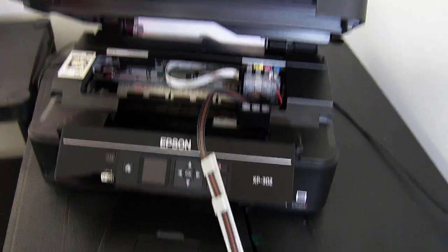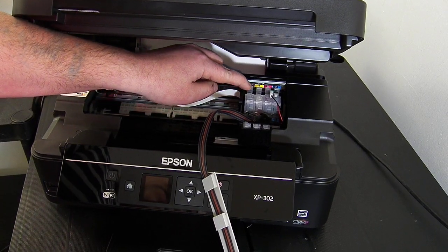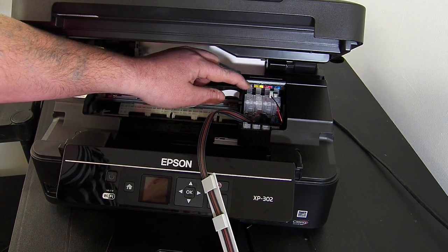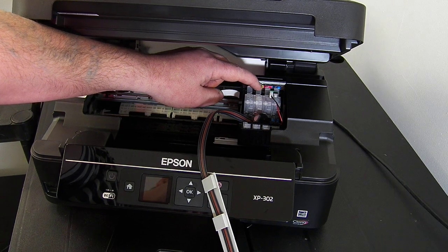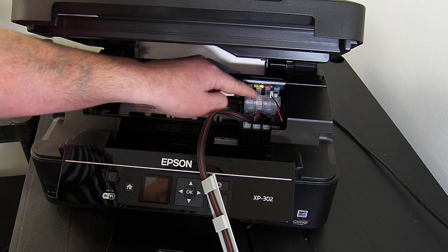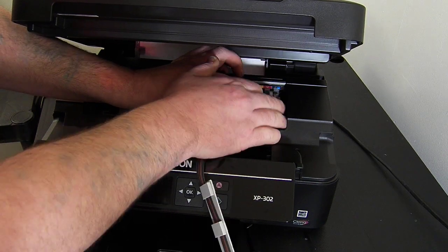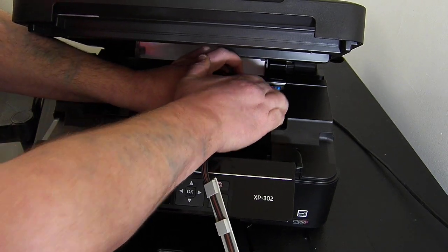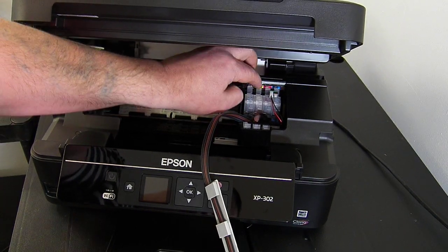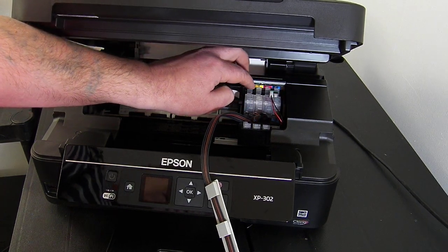When you're done you have to push diagonally down on these locating lugs. If you don't, the chances are that one's not going to be clicked in and it's just going to say it's not recognised. You may hear a click when I'm pushing these. You could clearly hear the clicks. Even though you push the block down, sometimes the locating lug is not located. So once it's been in, push diagonally down on all four locating lugs, repeat that a couple of times, and make sure they are fully located.